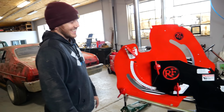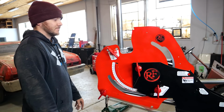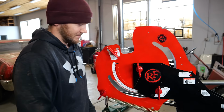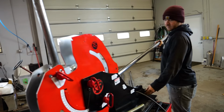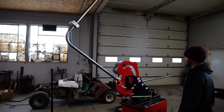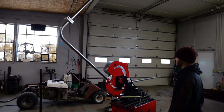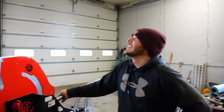All right, well, let's throw the clamp on our other bend and we'll leave this one here for right now. We're definitely not gonna have to resume that bend. No. But once in a while, if you don't overbend them, you do. You can leave your clamps on and resume a bend at any point. Just casually bending a 13-foot pipe in the middle of the shop. Easy peasy. That's the beauty of a vertical bender. The only thing you need is ceiling space. All right, there it is. Hopefully it works.